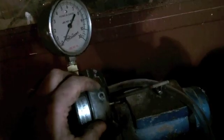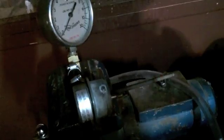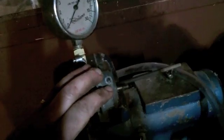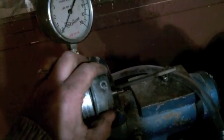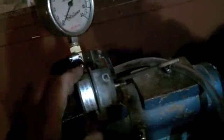This is all just seat of the pants as far as I'm concerned, and obviously if you're after something technical, you probably shouldn't be cutting this apart and welding it back together. That's really in the ballpark though. If you want higher boost numbers, obviously this could be done in reverse — you could take it apart and add something, but that would make me nervous. Making it lighter, you're not going to blow it up. Making it heavier, well, now you're taking your motor's life into your own hands, and I'm certainly not going to be responsible for that.